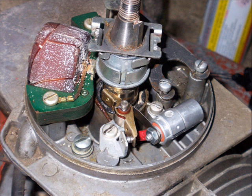Here is a close look at the coil pack and you can see the cracks on it. It needs to be changed, otherwise the cracks can leak the high voltage electricity and you will lose the spark.